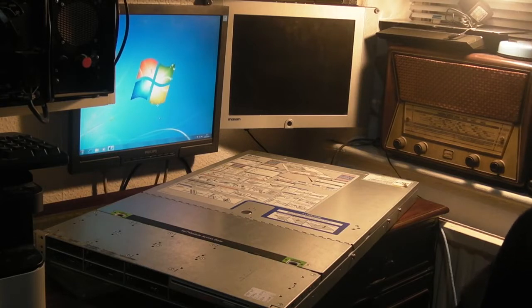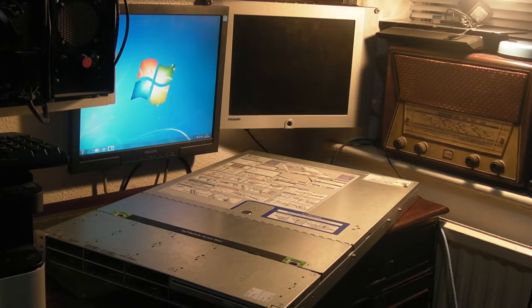But all is not lost, because there is a way you can modify an LGA 771 CPU to run in an LGA 775 CPU socket in that dual core board. And then we have to do a few little tricks to the BIOS, because obviously the BIOS doesn't know what a Xeon CPU is. It will actually run at that point, it's just that the benchmarking software and things like that will not be particularly happy. They won't actually know what CPU it is, and the BIOS will probably complain and say unknown CPU. But it should still basically run.